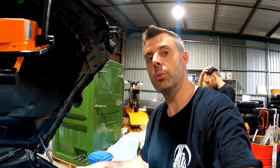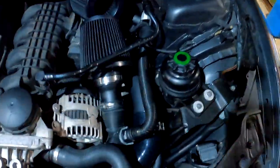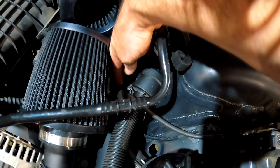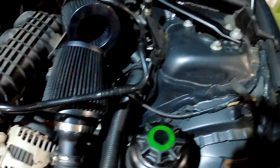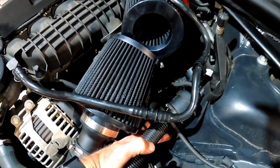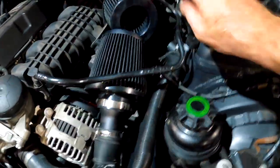The timelapse cut off abruptly because within a few minutes of trying to fit it, we could see it wasn't going to work properly. It's all in there and sort of okay, but I really wouldn't recommend one of these charge pipes. My biggest concern is the angle that the diverter valve outlets come out — the only way I can get the diverter valve to fit properly is with the silicone hose not fully on the charge pipe, and also not fully on the diverter valve. I've just run this car up with some boost and it seems to be holding, but it's just not right. I'm going to swap the straight silicone piece for a 45-degree bend, which should give me more clearance for the diverter valve.